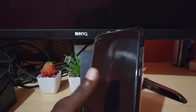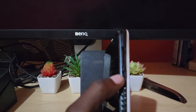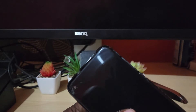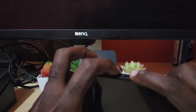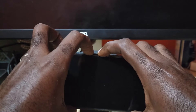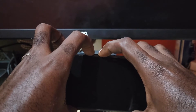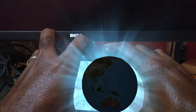In order to fix the problem, take your device in the state that it's in. Locate your power button, which is right here, and find your volume down button. What you're going to do is hold both power and volume down at the same time. Go ahead and hold both and keep holding until the device basically restarts. You may see nothing on the display — in my case you'll see something, but you won't see anything. Keep holding.